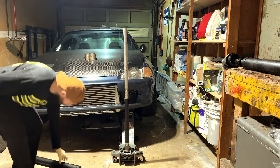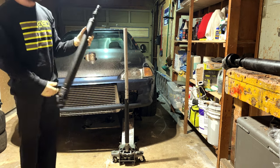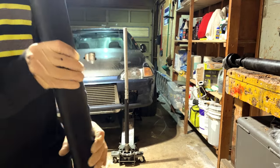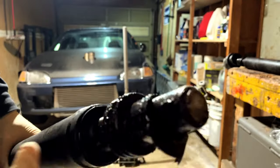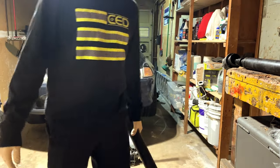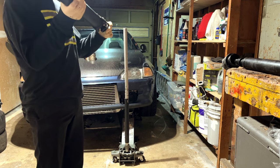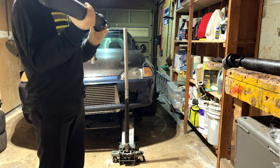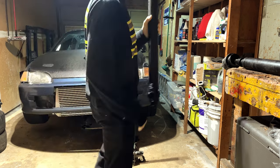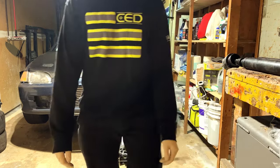Car is drivable again. This piece in my hand is a slip joint — take a look at that. Got the spline broke off right at the end from a hard launch. We wasted about five hundred dollars on this drive shaft getting it cut and balanced, so that's kind of a bummer.